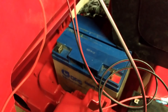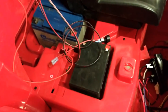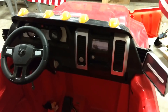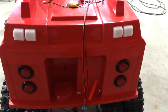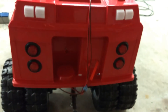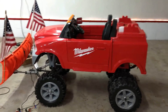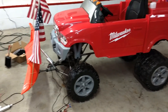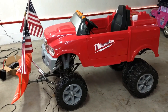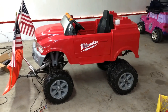I don't know if I ever even talked about this, but we're going to run 18 amp-hour 12-volt batteries under the seat — we've got two of those that'll drive the motors. And then we're going to have an accessory battery right here under the passenger seat. So we've got to start placing light switches, wind switches, and all that. We've got the rear LEDs in there. This truck is going to be awesome. There's some stuff going on I can't really talk about yet, but let's just say there are some people at Milwaukee that are pretty interested in this. If all this stuff comes together, you're going to see some crazy stuff. Thanks for watching and stay tuned for the next update on Project Heavy Duty.